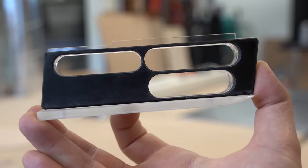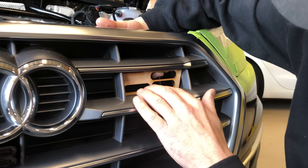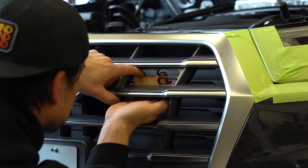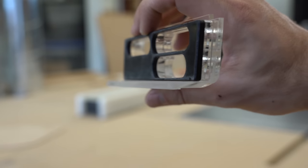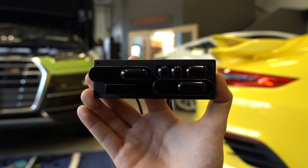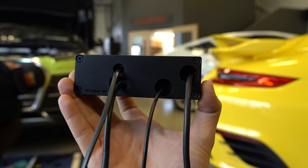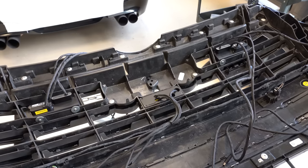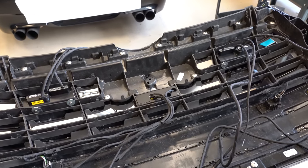For the front laser jammers, we adjusted placement based on bumper slat width and protrusion — making sure heads weren't recessed and nothing was blocking the jammers. The Audi logo in the center sticks out a bit farther forward, so the center heads had to stick out farther than the outer heads. Once placement was determined, they created special holders for the laser jammer heads designed in CAD, laser cut, and then assembled so the whole cluster could be inserted and secured right into the grille.